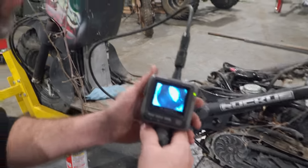A little bit of research, I found out that this thing has shims in it rather than adjustable rockers. Literally, there's a wear item in the valve train that when it gets slack, you have to replace it to make the valves in spec again. We'd have to replace a shim with a brand new shim, a certain size. And we don't have the kit. Of course, if it's out of spec, I'm gonna do it the Cars and Cameras way. You can actually sand on the back side of the shim and get it thinner.